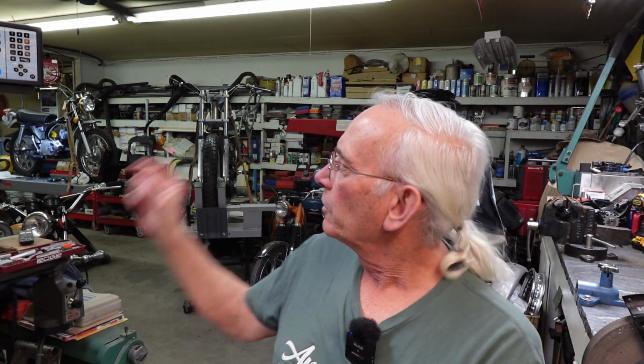Hey, today I'm going to get back on the Yamaha mini bike GT-1 GT80, and what I need to do to finish the bike up is to adjust the oil cable, or the cables, the oil pump, and make sure it's supplying enough oil to the engine. Been over there horsing around with it already, and there's just no way it's going to adjust because the cables are severely stretched, and I just cannot get to the adjustment.